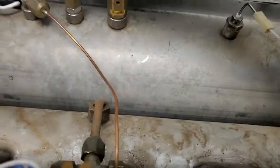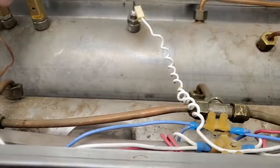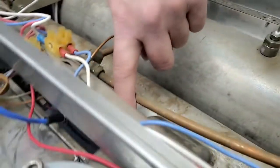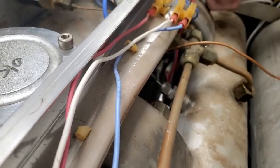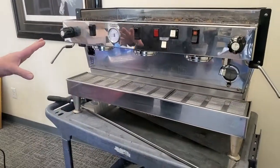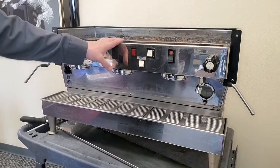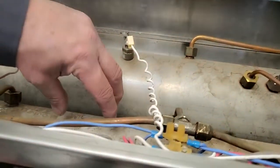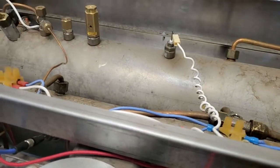Now we'll go to the brew boiler. Here's our water inlet pipe — cold water going in from our pump — and on the side of each group we have a water fitting going out into our valve. If this was an automatic volume dosing machine, the flow meters would be accessible from the top, positioned right about here at each group, right in between the two boilers.